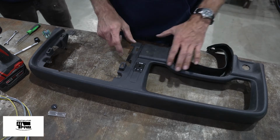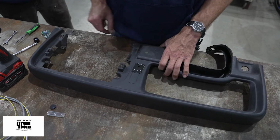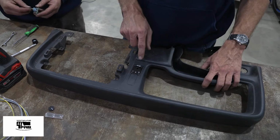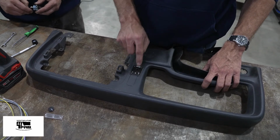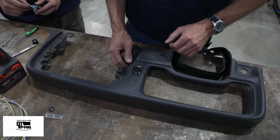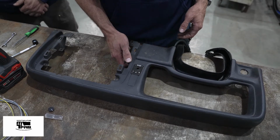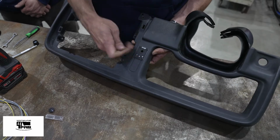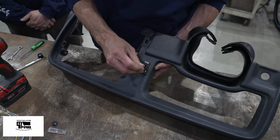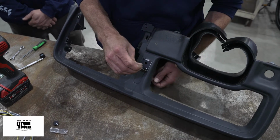Now that I've drilled all 4 holes, I reattached the plate for the final time. Now, I put the sticker on, and it's important to remember, before you put the sticker on, clean the aluminum plate very well with a solvent like brake clean. Then, as you tighten these 4 set screws, it's very important not to tighten them too much, because as I tighten these screws, I can cut through the sticker and then your sticker will start peeling off. So our recommendation is hold the Allen wrench and tighten from the back.